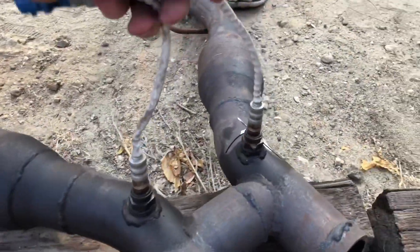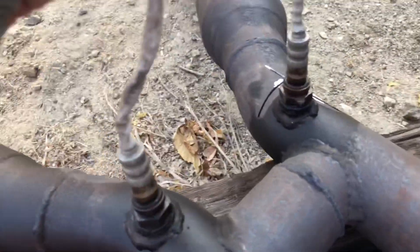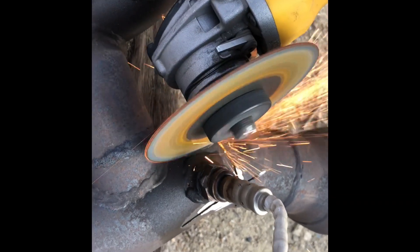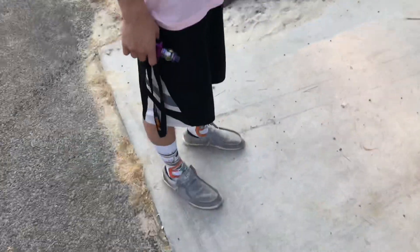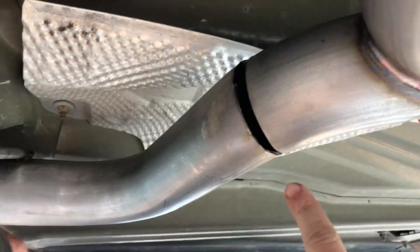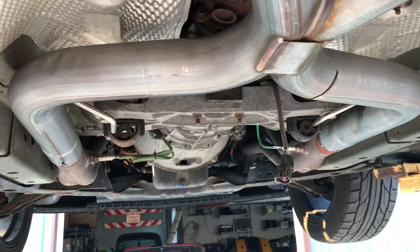The problem is we can't get the O2 sensors out, so we have to take the O2 sensor out whole and we're going to weld this square into there. We had to bend the pipe widely because it's not the right size. We cut a slit all the way through, and then bent it out because the x-pipe was angled inwards and we had to spread it out to match the headers — this x-pipe wasn't meant for this set of headers.